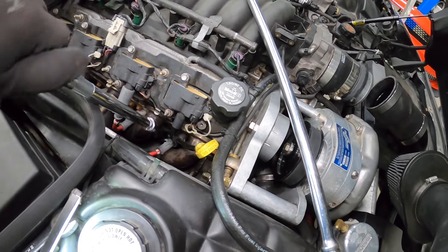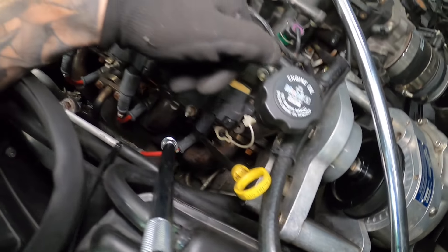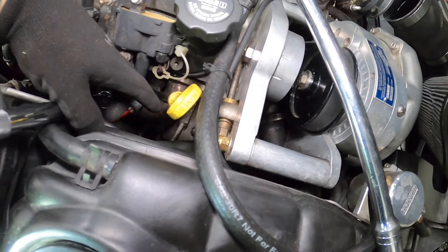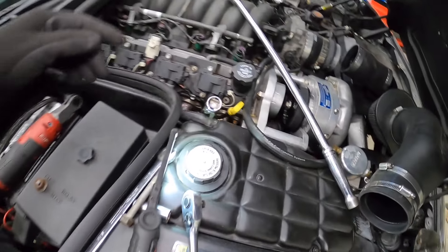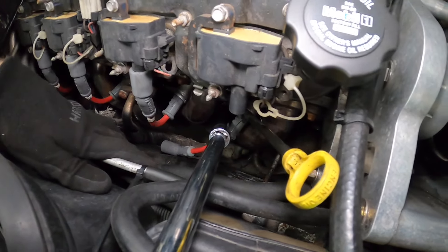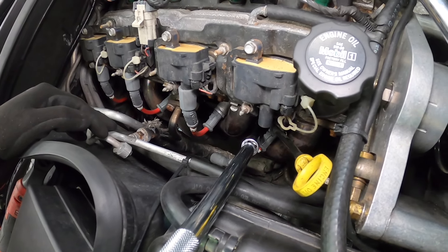I managed to get the 18mm nut from the top so I got that one off. Somebody had already disconnected the AC compressor — it's just sitting there and looks all seized up. I'm going to attempt to remove it. I've seen people take it out the back by removing the exhaust; I'm going to try, since I have the mono leaf out, to see if I can drop it through that hole — which would also let me squeeze some of this other stuff through.